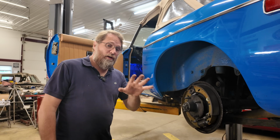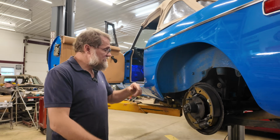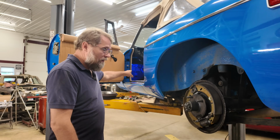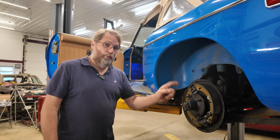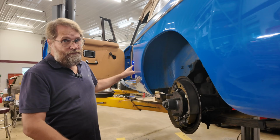So many of you may already know, and some may not, that the majority of your braking power, about 70%, is actually coming from the front brakes, not the rear. But when you're pushing on the pedal there, most of that feel and the height actually comes from the rear, and the adjustment is critical to get good pedal feel.